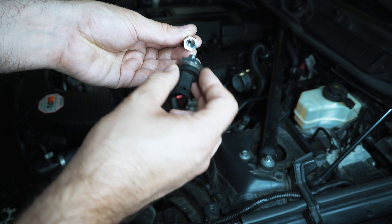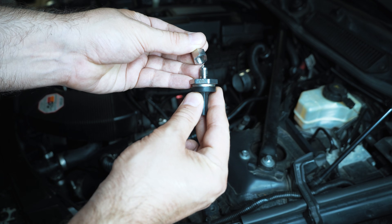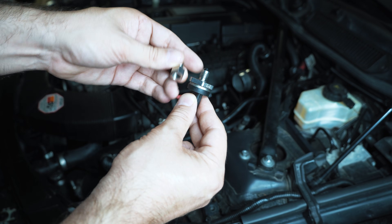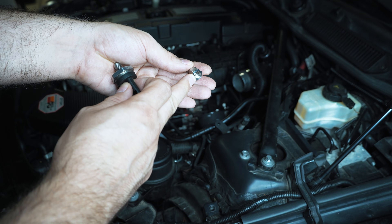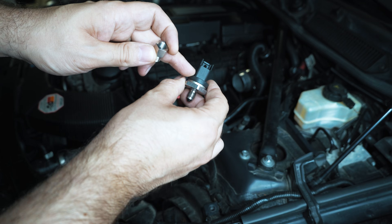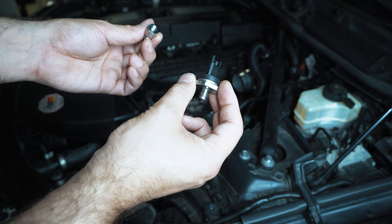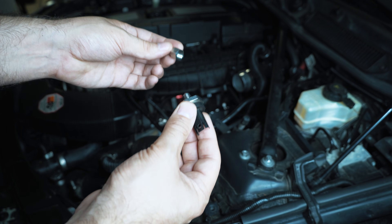This adapter is basically designed to interface with the sensor — on one side it's curved on the inside so they can bite into each other and seal properly without an O-ring, just like a factory AN style fitting. That's what you would have got if you opted to go for the upgraded line. The whole kit would be around $180 instead of about $40 for the sensor or $60 for this kit with the adapter. If you're going to the newer generation sensor, which is recommended, you want to run the adapter — no point buying the original sensor anymore.